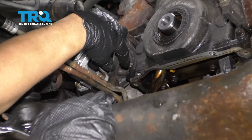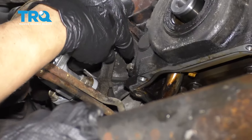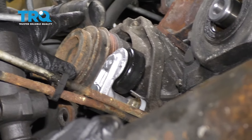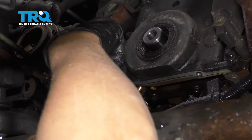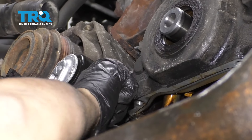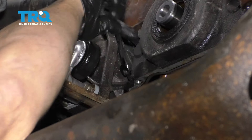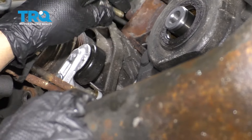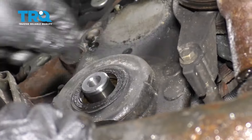So we're gonna take this bolt out without taking the AC compressor bracket off. If you are having trouble getting access to that bolt, you can take the compressor off — just don't disconnect the lines. Take the bolts off the compressor and then underneath that, you can access the bolts for that bracket, but that's gonna take a lot longer. So to do it quickly, we're just gonna use an open-ended 10-millimeter wrench. That's significantly easier than taking that bracket off and saves you a lot of time. Then take the rest of the seven bolts out with a 10-millimeter socket.